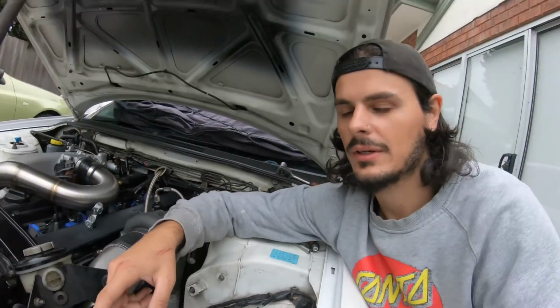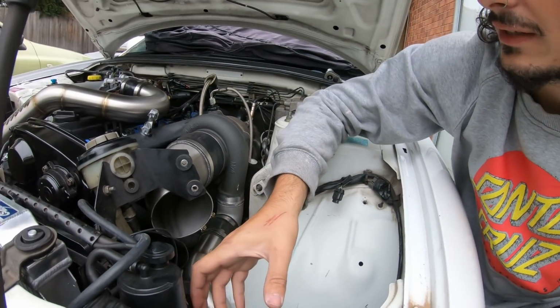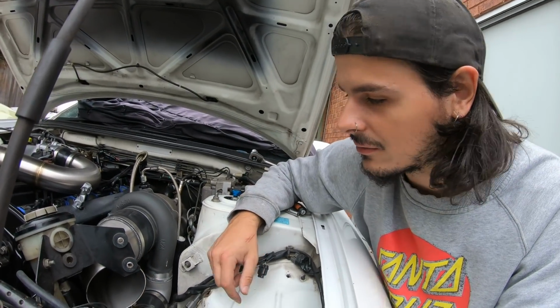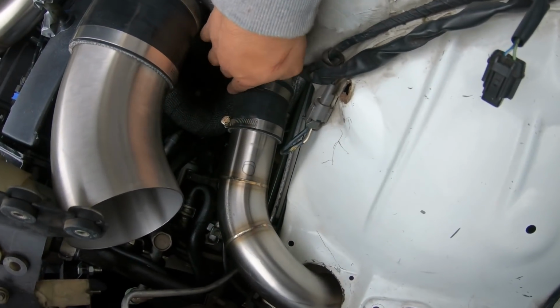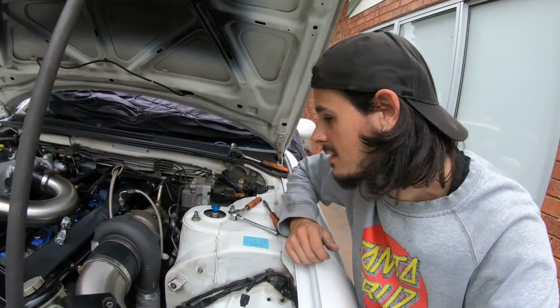We're going to put it here, so I'm going to get Bevan that did all the intercooler piping, just get him to make a bracket for me, because we're going to chuck on the power steering reservoir here, and then we're going to run a line to here, chuck some heat shield sleeve on that as well, even though I've got it wrapped up the exhaust manifold. If you can see, it's nice and wrapped so it won't burn the hose for the power steering lines.